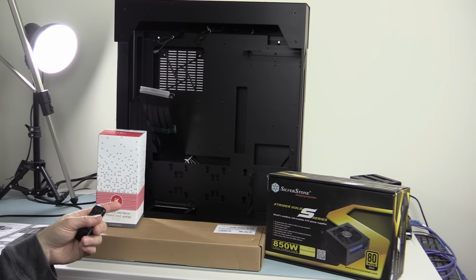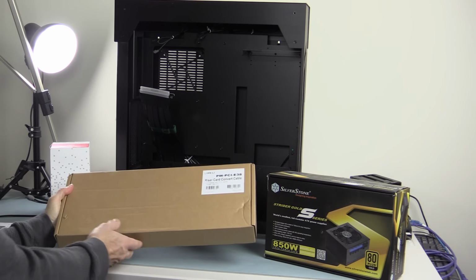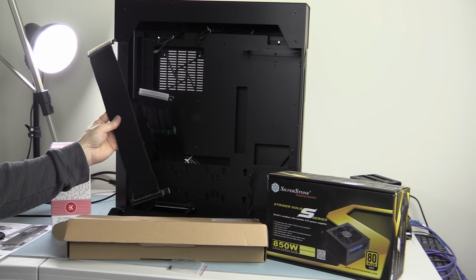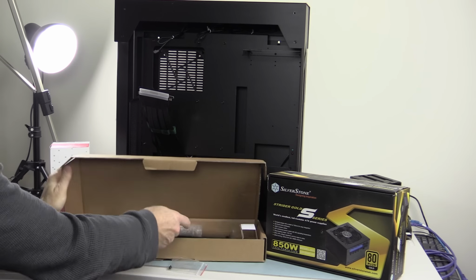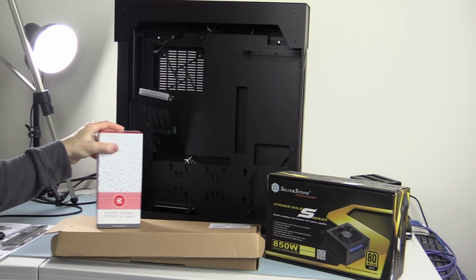Let me go ahead and remove this bracket and install the power supply. The other thing we have going here is that since I plan to put 2 cards in SLI if it'll work, I have the Lian-Li additional cable. This is the same thing that you have here, except that one's a little bit longer. This one actually is nicely sleeved and protected, but you won't see it. It's going to be mounted there, so I've got to work that in and see if that fits. And then finally we'll be working on the radiator and the fans up in the top. But first off, let me take this thing apart a little bit to get in the power supply, and then see how we're going to route the pump and the reservoir setup.